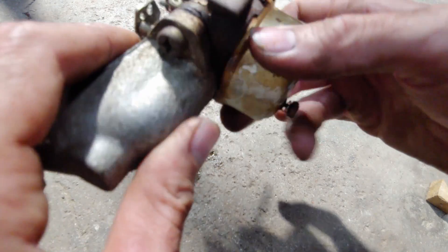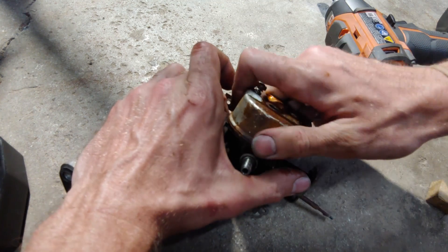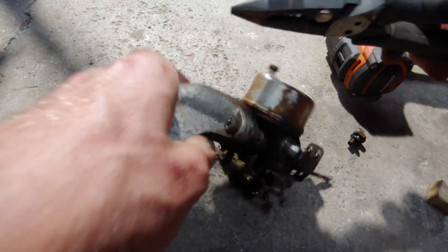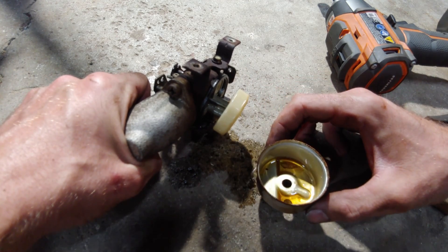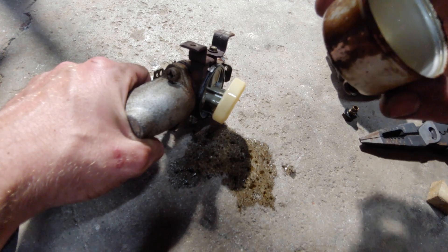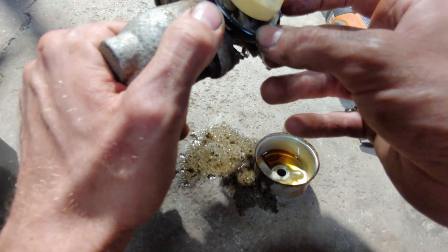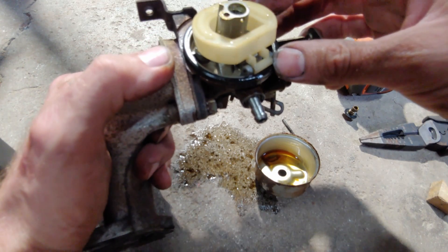Get all the gunk off and flush the fuel line and get it back together and see what happens. I really hope this fuel gasket doesn't get torn so I can reuse it - it's going to take forever to get this stuff in the mail if I order it. It doesn't look half bad honestly. I was expecting it to be really rusty and just full of ethanol and stuff, but I'm pretty impressed. I can definitely see there's some water in that gas though, so that could be a problem. I'll throw the compressed air through it a little bit, get it all cleaned out and put it back together. This gasket looks like I can reuse it for sure.